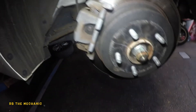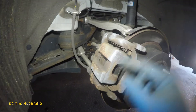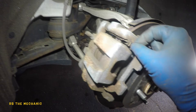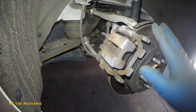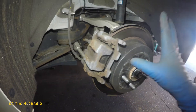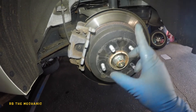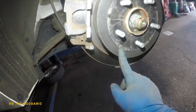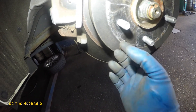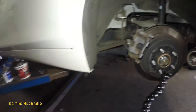You need to save this little plastic piece here. I determined that the hardware is pretty good, so we don't need to go crazy — just clean them, lubricate them, and put in new brake pads and rotors. There are e-brake shoes in there. Clean them if you want, do two or three clicks adjustment, no more than that. You can always access them from this hole.